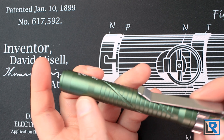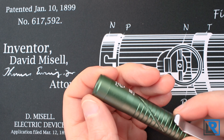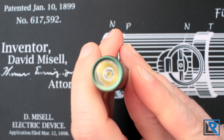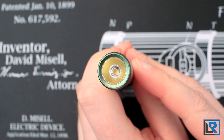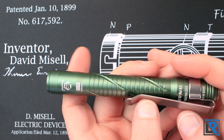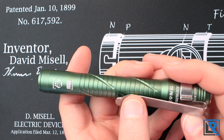Up front it does grow in diameter just ever so slightly, which you can barely see. The front is glued on but does look like it's removable — I couldn't get it to move myself. Underneath in the center there you do have a TIR optic reflector and a piece of anti-reflective coated glass. Internally there is a 600 milliamp hour lithium polymer battery sealed in the light. It is non-user replaceable.